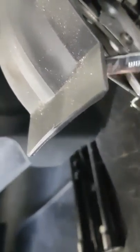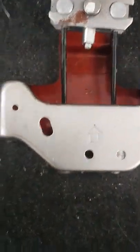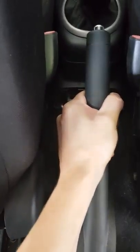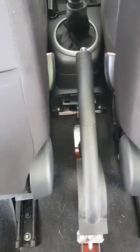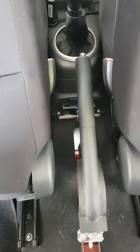You can adjust it depending on how tight you want it, but you don't want it too tight because you could stretch the handbrake cables, which means you'd have to replace parts. So maybe do it at five or six clicks — if it feels super tight after the fifth or sixth click, stop tightening. Okay, thanks.